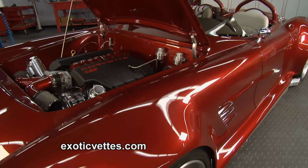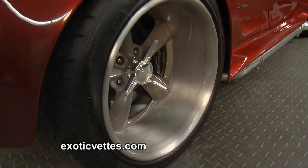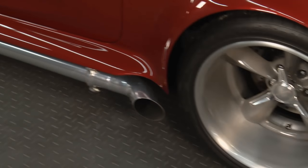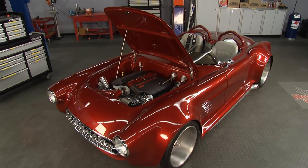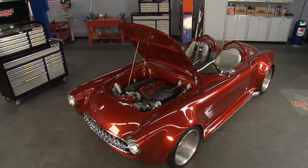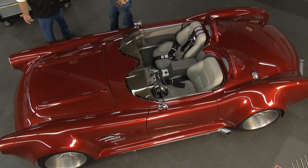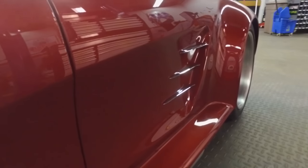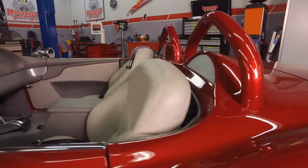What's really impressive are these ginormous tires, front and rear. What did you do to get them under there and what's the size of these things? Well, the rims are 18 by 12. The tires are 335s all the way around. I wanted it to go around the corner, so basically what I did was I built the chassis with the wheels and tires on it and built the body to fit the chassis, so that all the steering clears — no interference anywhere. And it'll do that with the rack and pinion, no rubbing issues at all, and it's fast.